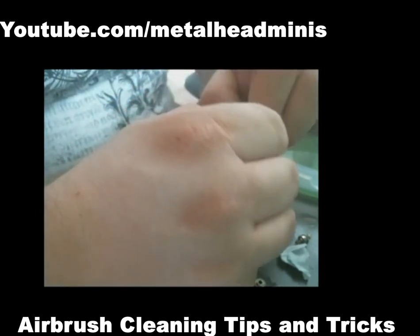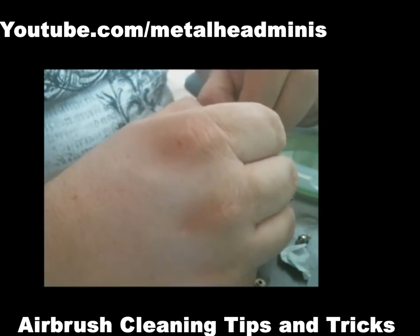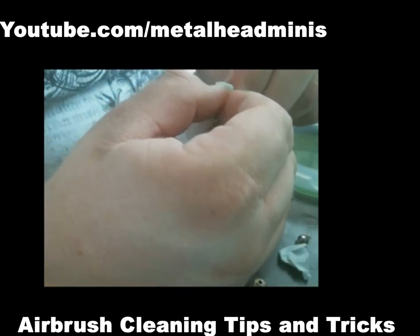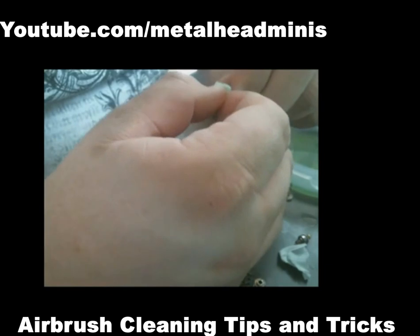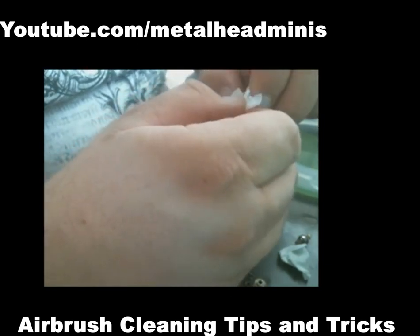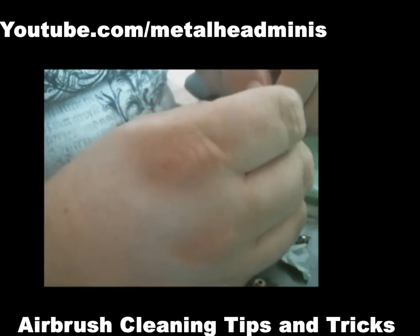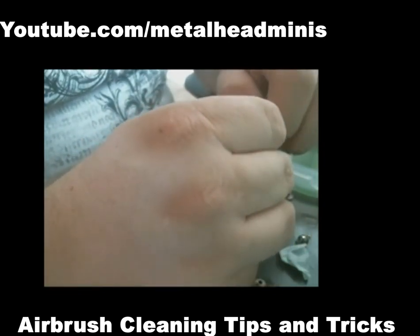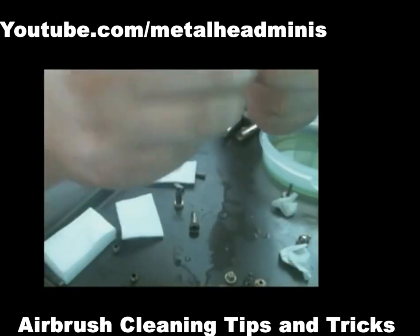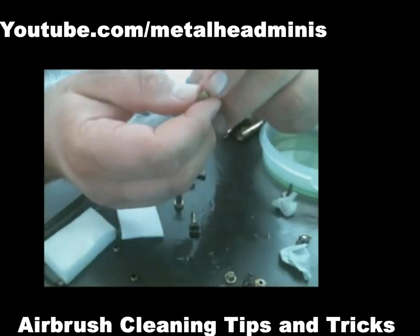Another option that you have is you can put it in a toaster oven on some low temperatures for a little bit just to bake all the water and everything out of them. It's not really going to hurt the plastics or anything like that. Obviously, don't put it in at 5,000 degrees, but 100 degrees for 10 minutes or so shouldn't hurt it. Just check it periodically. But this one looks much better now too.